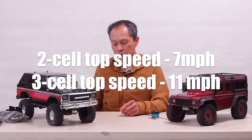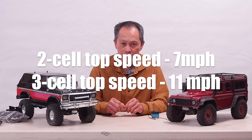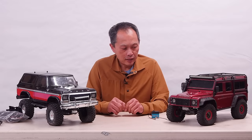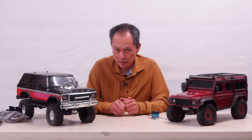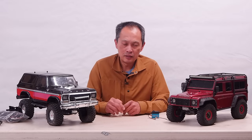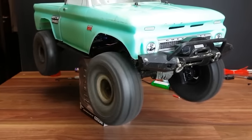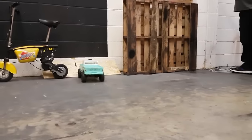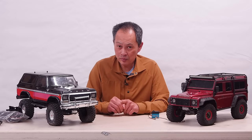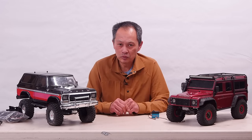You could change your pinion gear to give you more speed, and you could do that because you have a two-speed transmission anyway — you have a low gear and a high gear, which gives you more options. And finally, you could use a brushless system. Brushless systems are these new motors you find in scooters and drones that are way more efficient and way more powerful. There's the Castle Mamba X, which is just an amazing powerhouse. It'll get these things up to 30 miles an hour and maybe more. And these machines can take it — they're bulletproof drivetrains.